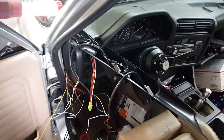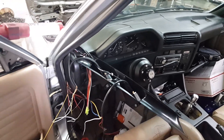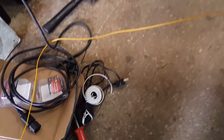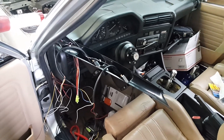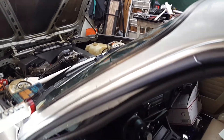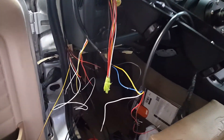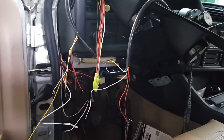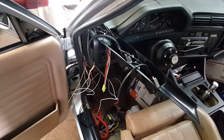These wires will come down more once the gauge is in further, but once I get them soldered I can fit this back up and screw it back up to the pillar. I have this other yellow wire still hanging out because I'm not sure how long I want it yet, since that will be going over to where the O2 sensor is. I'll be connecting a factory pigtail to it so I can just screw it into the O2 sensor connection, and that will give the ECU the signal for the air-fuel ratio.